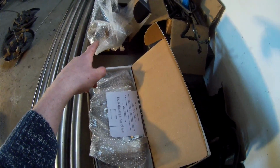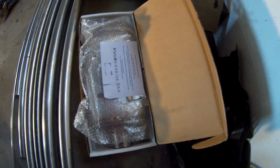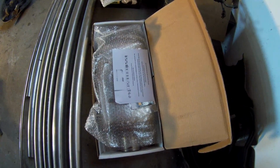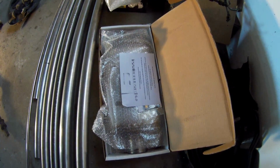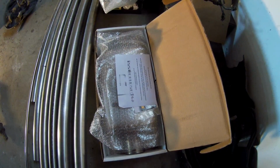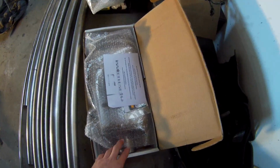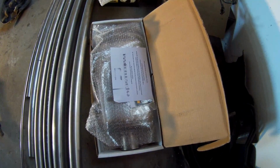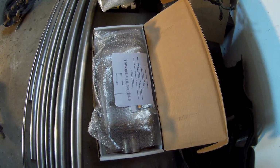So this is a straight through damper X pipe, and here are plates in between. So I have to get some sound insulation, to get it not too loud, because I have to do some sound measurements. I thought it was 3000 RPMs. At 3000 RPMs you can get 90 decibels or something. So it's also not that loud because it's very flat. That's also why I chose this damper, to get all the exhaust flows in one pipe, to get the sound a little bit lower. And afterwards I can get 2 separate exhaust flows outside, just for fun.